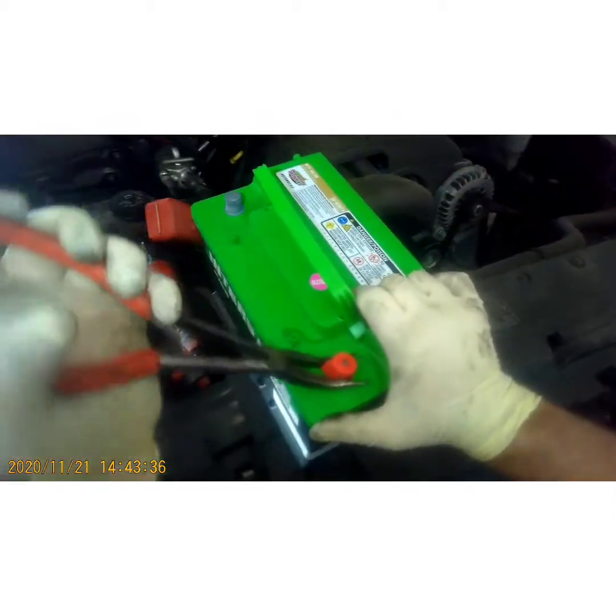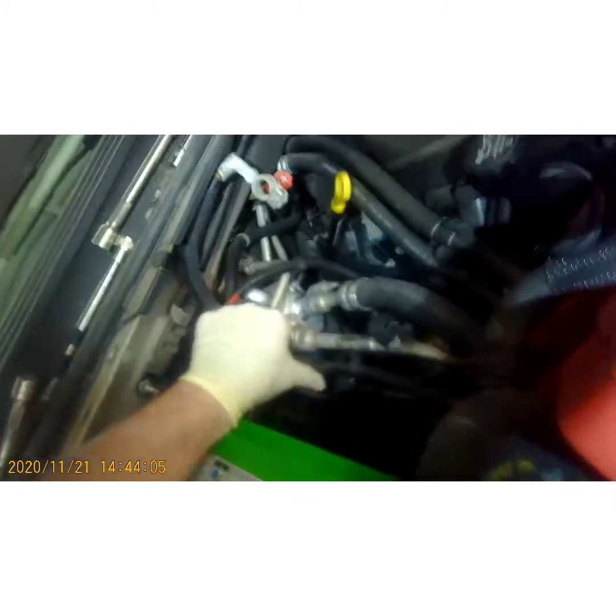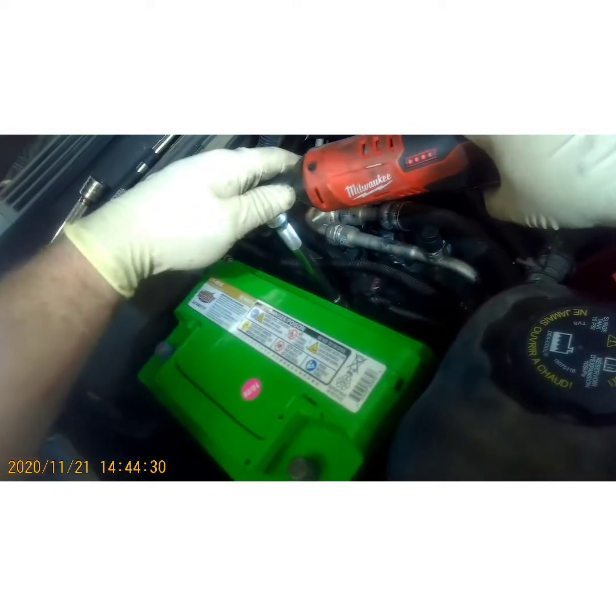Everything's a mess — I've been working very hard today so I haven't had time to straighten things up. Your negative goes towards the left, towards the back of the car. Slide it in there and lock it into those little grooves in the back until they seat. Grab your hold-down again, start the bolt by hand, and lock that down.